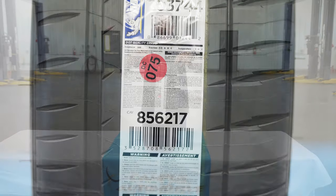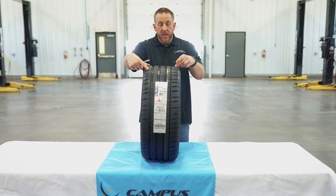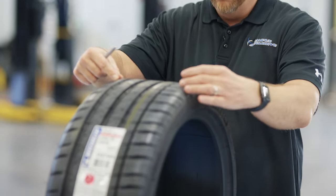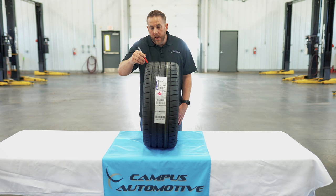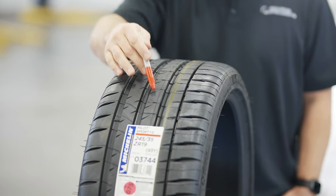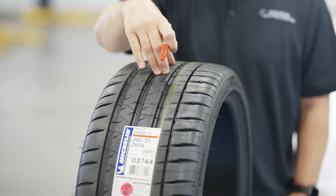Literally, as you load and unload the tire, it deforms on each side — so the contact patch will actually be smaller on one side and larger on another depending on if you're turning left or turning right. You can't really see a channel that goes from the groove to the outside of the tire like you see on some other tires, but since these grooves are so big that'll still allow you to have traction. This center rib is continuous, and that's how they sort of changed it and give it a 30,000 mile warranty.